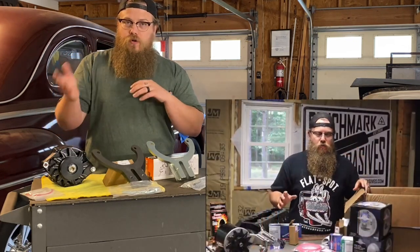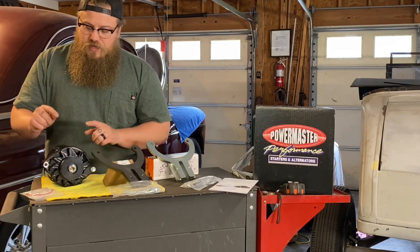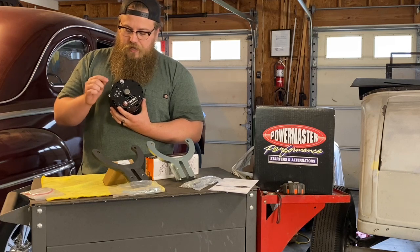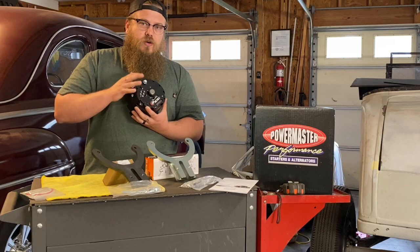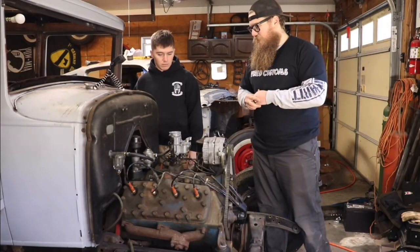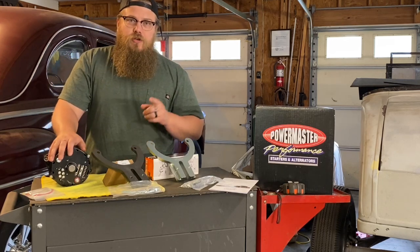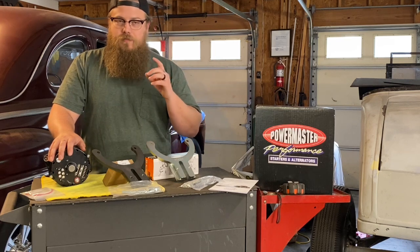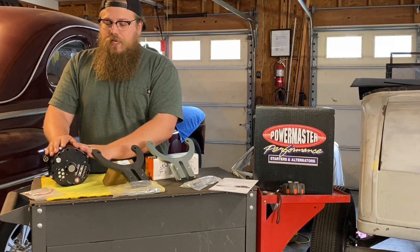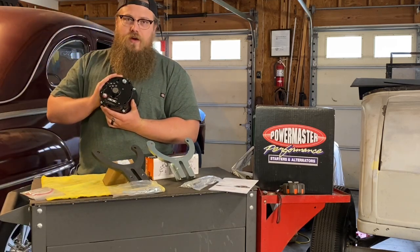I have a whole video explaining the whole 12 volt conversion process. Now these alternators — I really like these because you do not have to raise the idle. What we have here is pretty much a GM one wire alternator. One wire goes to the battery — that's how I like to set it up. We also have another bolt on the back that's going to ground the alternator. It's extremely important that you ground the alternators. These old engines, when converted from 6 volts to 12 volts and after all these years, the wiring could have changed or done something funky. Even crusty intakes mean you will not get a good ground off the motor. Make sure you run a solid ground from the battery to the motor, and motor to frame, every single time on any vehicle you're working on. Make sure you have a good ground for the alternator — I like to use this ground point here. You can know it's grounded all day long, no problems.